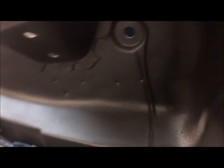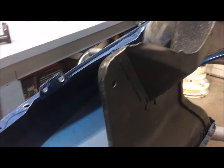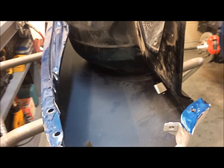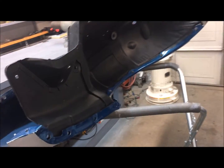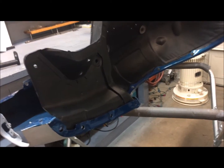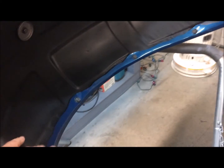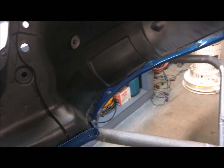I will turn around and set the fender in place, and then start lining it up with the shims and everything, and get it together. Again, this is the way I do it. Not saying, to me, this is easier. This is easier than putting the inner fender on and trying to fight with these bolts down here and getting those lined up, and it's all together and it's all loose.